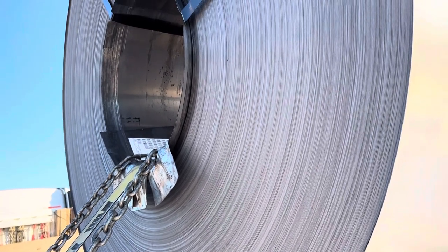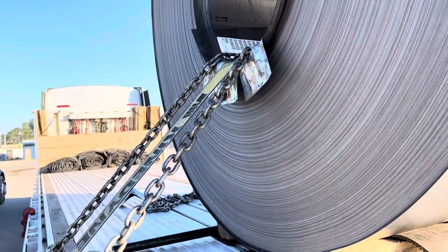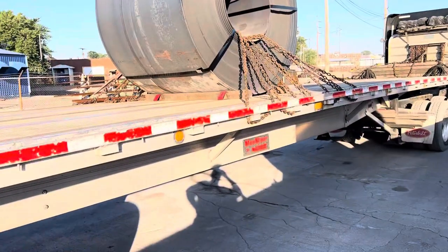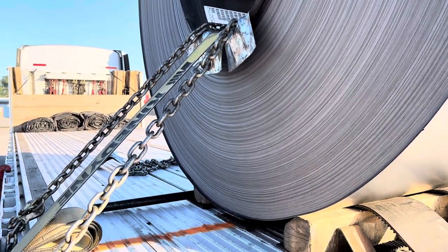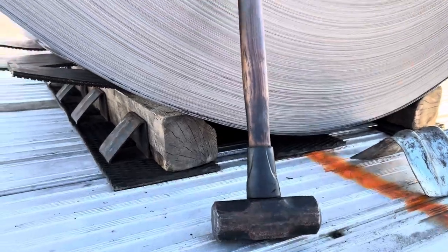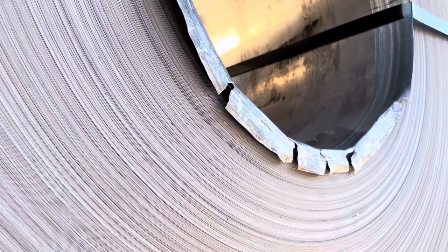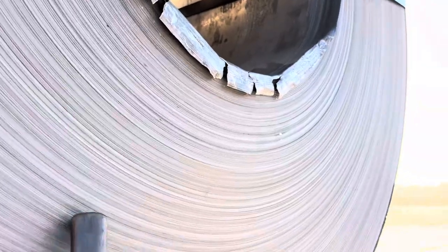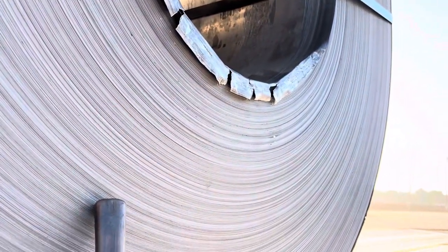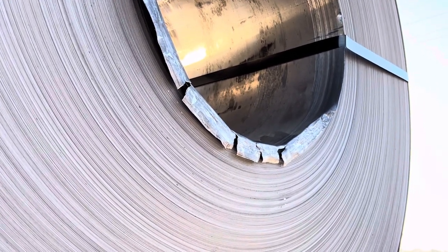That's the thin lip. If I go over there and crank on the binders, I can bend that over some, but not enough. I'm going to get out my hammer and tap that back in or at least flatten it out. So there's two good learning things for you guys — don't be this guy, and don't miss this. This is why I carry a little sledgehammer — it's also my tire thumper. Did you see how I got that all bent over? That'll be fine. Look how much that could have been — that would have bent going down the road bouncing, and your chains would have been completely loose. So don't get in a rush, guys. If you don't have a hammer, tell them to help you or refuse the coil.